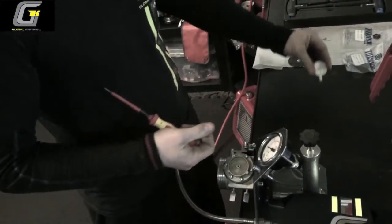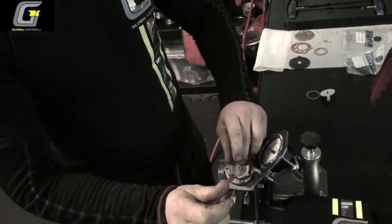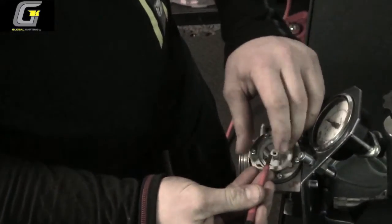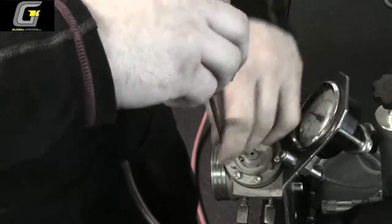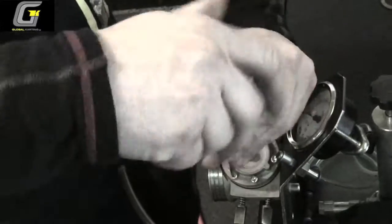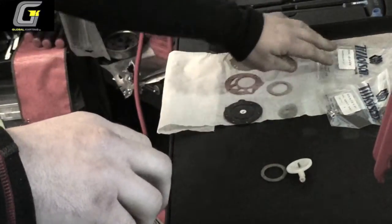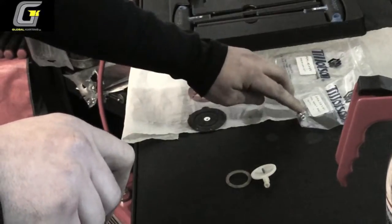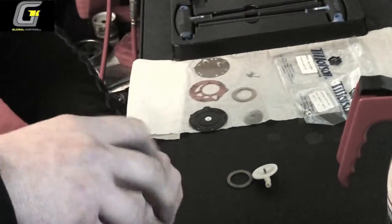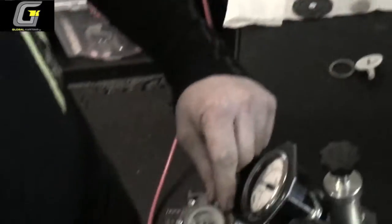That's your carburetor top, pretty clean as it should be. These don't come in the kit so you have to be careful with these, clean and reuse them. Make sure you lay your gaskets out that come in the kit. This is the specific kit you have to use — the RK6HW — and it's a complete kit that comes with a needle and seat as well. The only parts you have to reuse are the filter that goes in the top and the spring that goes under the paddle.